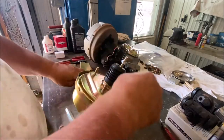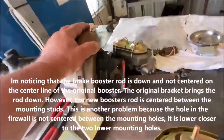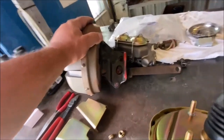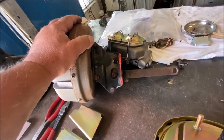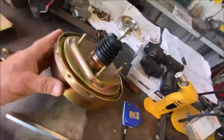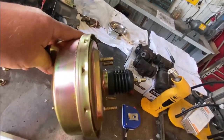Let's see if this will just bolt right up to the firewall without a bracket. Look at that - it's lower, it's closer to the bottom bolts when sticking straight out than the upper bolts. It's not centered between the bolts. The original is centered. That won't work.